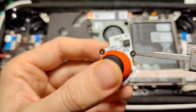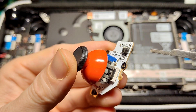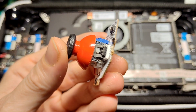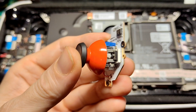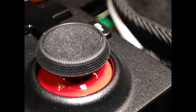I was surprised to find that the AlecGear thumbstick uses the exact same shims for the same purpose, already applied to the thumbstick's PCB board. You can't see them in the Amazon listing pictures, so I'm not sure when they added them, but it must have been recently. The shims are removable — on a stock deck, in my case, they were never needed as the thumbsticks could move freely without the extra distance. The best way to check is to apply them, tighten the screws, and check the gap between the half dome of the thumbstick cap and the edge of the hole in the front shell.